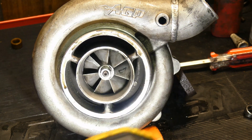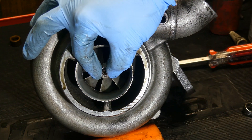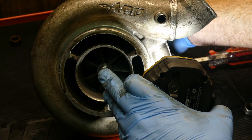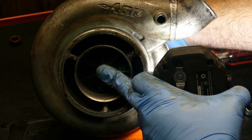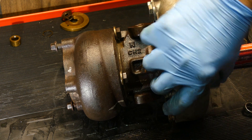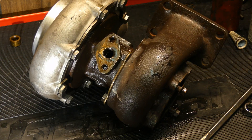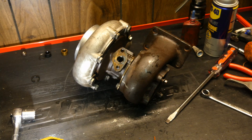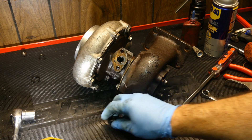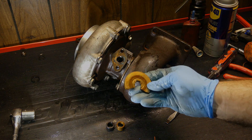Once everything is back together, be sure to check the shaft play again. This one is nice and tight laterally with just a hair of movement radially, which is perfectly fine. This turbo based on inspection was probably okay to run, but you always want to rebuild one for peace of mind. Also be sure to prime the turbo before you run it for the very first time on your engine. There are some good deals to be had on eBay when it comes to second-hand performance parts, but you just want to be thorough with the inspection. We got lucky with this one, but I've been burned before, which is why I wanted to make this video. Knowing what to look for and how to rebuild turbos can really save you money and headache. I hope you found this video informative — like and subscribe, and hit the notification button so you don't miss the installation of this turbo. Thanks for watching.